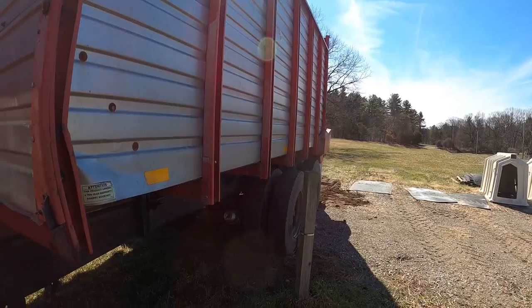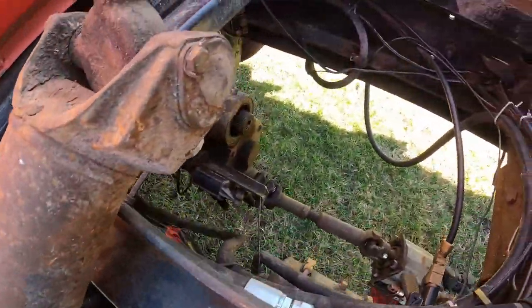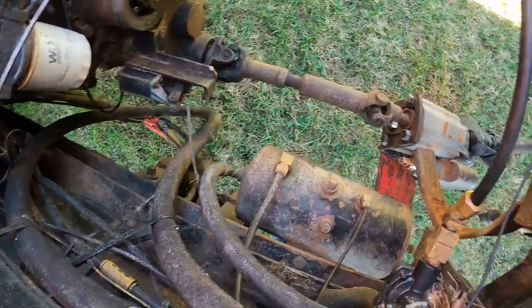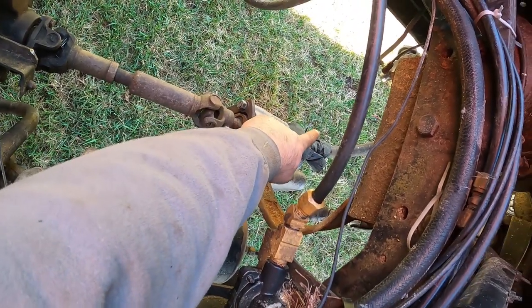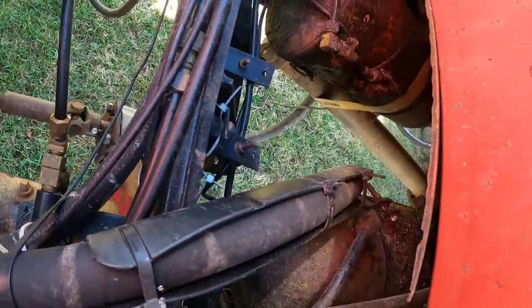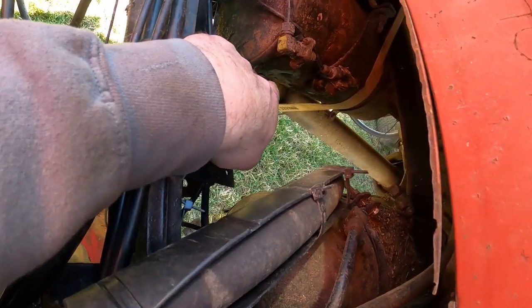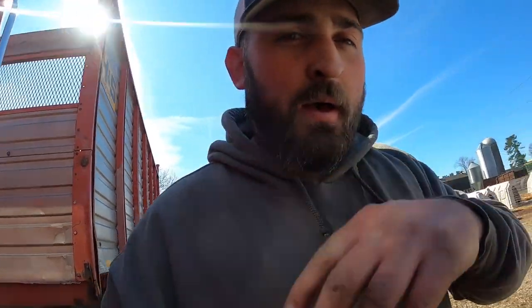If you follow me on any of the social media accounts, you know last fall I had a drive shaft failure, lost the carrier bearing that came around, popped everything apart, bent the bracket, snapped the line feed in, so it dumped everything. The back carrier bearing is still good, but this shaft came around because it all came unhooked, punched a hole through this air tank and ripped the drain valve off that air tank. So had to get this towed home.